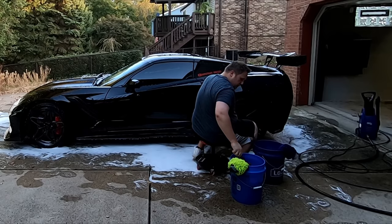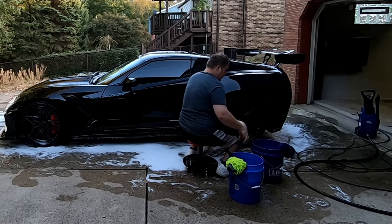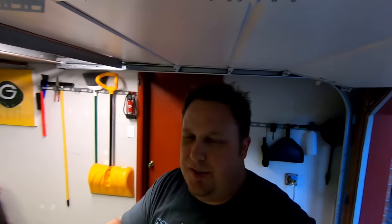Now I'm going to use the blue microfiber wash mitt and a Speedmaster wheel brush to clean the wheels, then pressure wash it all down. After it's washed down the last time with all the soap off, this is where your drying method comes in. I'm going to hit it with the spotless wash and then the Master Blaster. If you don't have those, a leaf blower works fine for a touchless dry. If you have no other option, use a high-quality microfiber towel to finish the drying process. The name of the game is to touch that paint as little as possible.